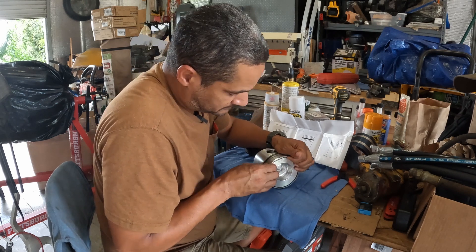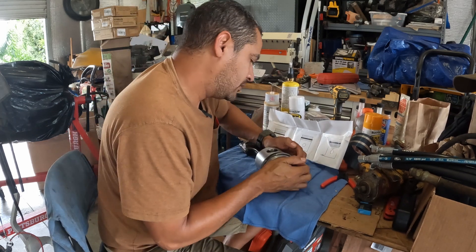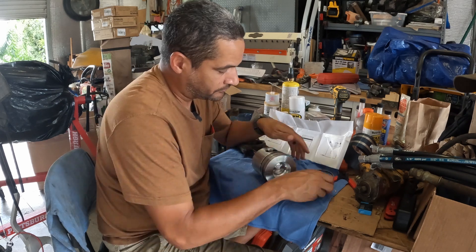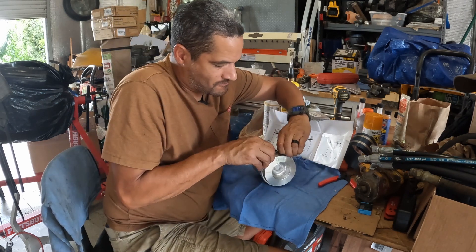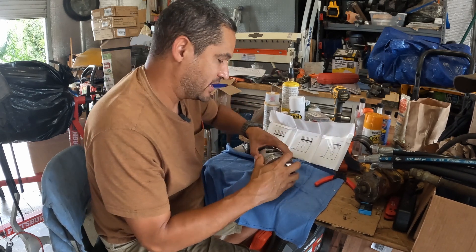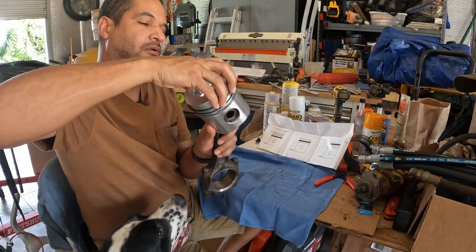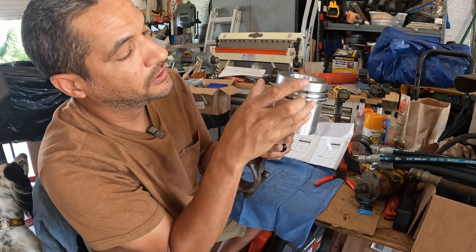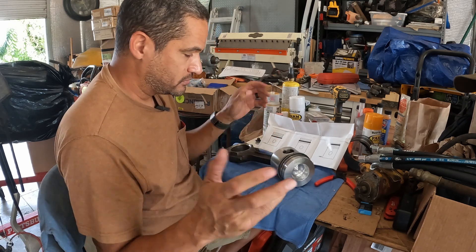And the last one. That wants to pop out, so I'm going to put this spring in first, and then the ring. It just has a groove in there for the spring itself. I'm just trying to tuck that spring in there. All the rings are in. They all have gaps on them — obviously. When you put these gaps in, you have to stagger them so that the gases don't get by — oil, gases, all that stuff — don't escape the cylinder.